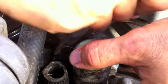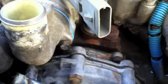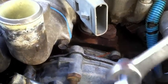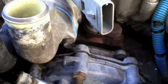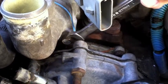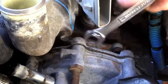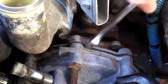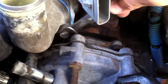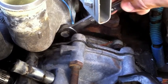This sucker was jammed up, which is just great news for Jeff. Because last night he was getting a little concerned about this. So we may have fixed his problem for much less money than a new radiator. This is a thermostat — a jammed-up thermostat. So if we get this done, it's going to cost him a lot less than it would have cost to change the whole radiator out.